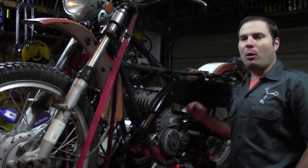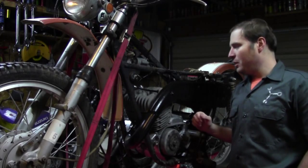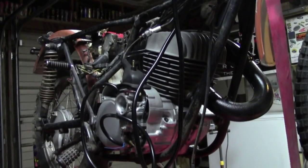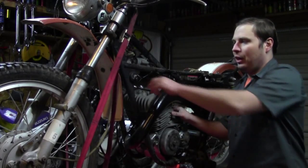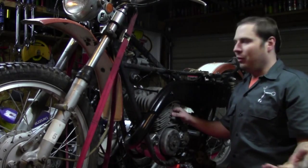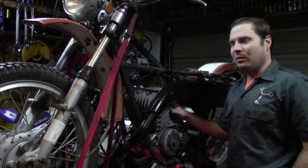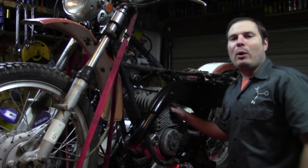Just a moment ago we had spark. With the engine back in and all the electronics hooked up, I got the carburetor back together — clean and set to factory specifications from the service manual. I hooked up an auxiliary fuel tank and auxiliary oil tank, since this is oil injected, to attempt to start the bike. I tried starting it off-camera — it ran for a few minutes, I shut it down, started it again, ran a couple more minutes, shut it down, and did a few heat cycles to break the engine in. When I went to start it a fourth time to fully heat it and check our tuning — it ran really good by the way — but now I don't have spark.